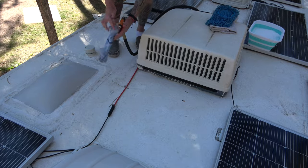But I am gonna do just a quick visual inspection, and then we'll break out the hose and we'll rinse everything down. And as we're rinsing everything down, that's where you will see a very important safety tip, which is don't try to stand up on your roof when you've got Henry Tropi-cool on the roof. It is silicone. When silicone gets wet, it gets slippery, and you don't want to fall off your roof. You don't want to fall on your roof. You don't want to fall, period.